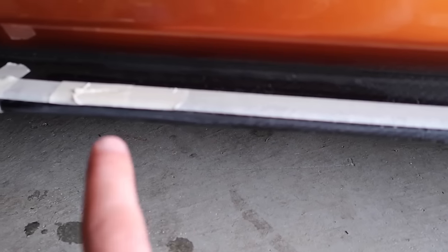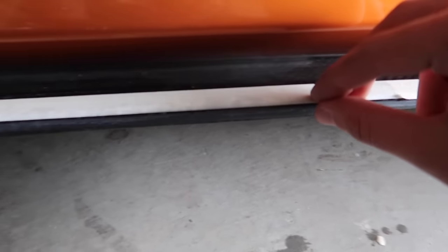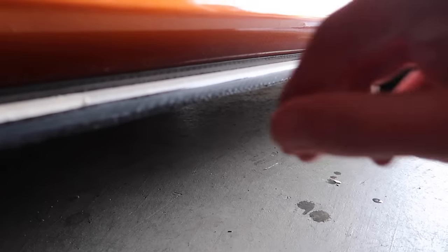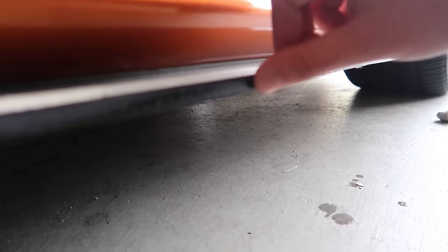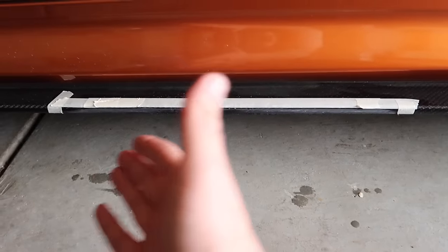I just remembered you need some alcohol to prep the area for the resin — the coat you're putting on to fix it. It's sanded pretty well. You basically just want it as smooth as possible. I can actually see the carbon is slightly cracked, but you're never going to see any of that from the bottom. Let's get some rubbing alcohol and just wipe this down.